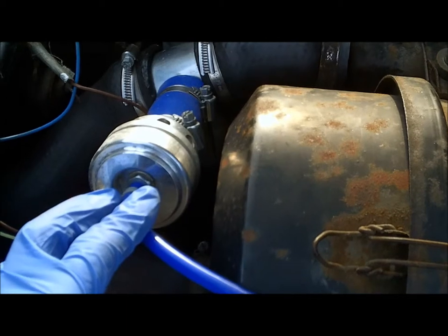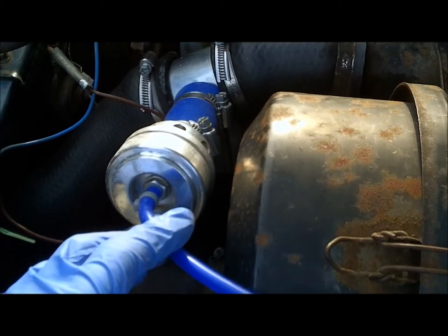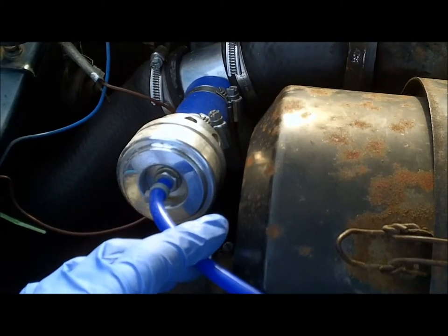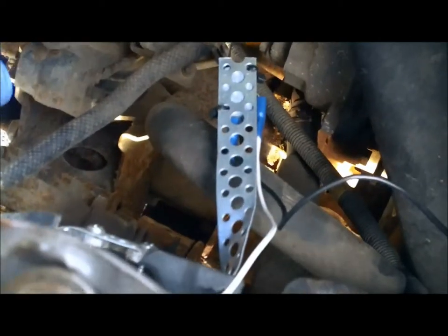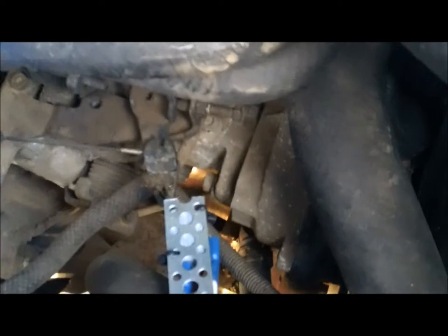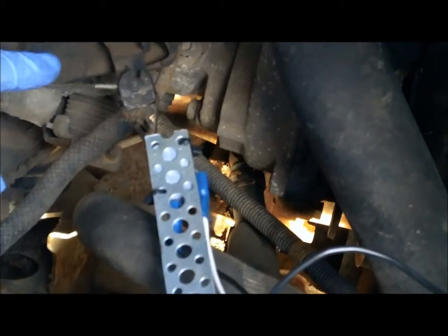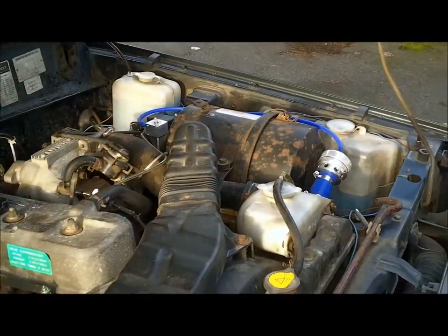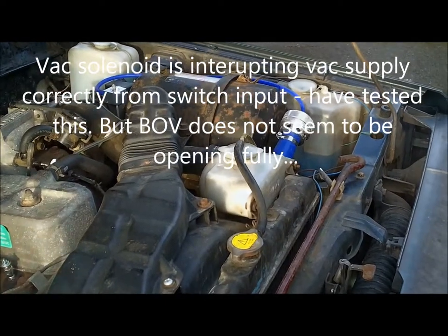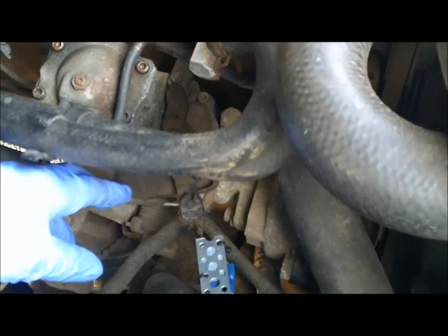There's no discernible release of pressure. I'll quickly film it with the engine running and try to get the thing to click on and off and show you just how quiet it is. This is the connection I've got on the throttle body switch — the switch is connected to the end of the throttle here, and you can clearly hear it clicking on and off correctly. So I know that the solenoid valve is opening and closing as it should be; it just doesn't seem to be operating the valve itself. I'll quickly rev the engine and put the camera next to the dump valve.